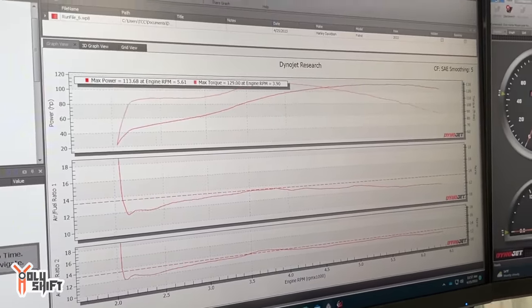This is the same setup as yours — the Thunderbacks. You got three more horsepower and a little more torque with the Thunderbacks. He had two-into-two exhaust. And here's one very similar to yours — a long Thunderheader. Same torque, but a couple more horsepower points out of the Thunderheader, because it's a high two-into-one that's way longer than yours. So we're at the numbers where we said we want to be in terms of reliability — not running lean, sacrificing a few points for reliability. You're not going to feel two or three points of difference.